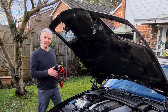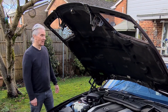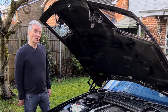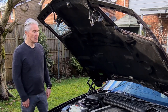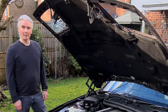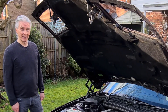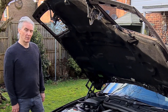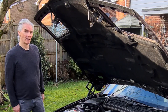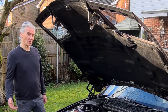Well, from my long experience of over 30 years with BMWs, the best place to put these jump leads is as far away from your BMW as possible. The old BMWs do not like being jump started one little bit, nor do they like jump starting other vehicles. I've seen so many cars that have been damaged — one even to a point where we couldn't fix it after about six months of trying. The old electronics really don't like it. Now, when you get to the E64 they're pretty much more immune to high voltages, but even with that car I wouldn't jump start it, nor would I use it to jump start another car.